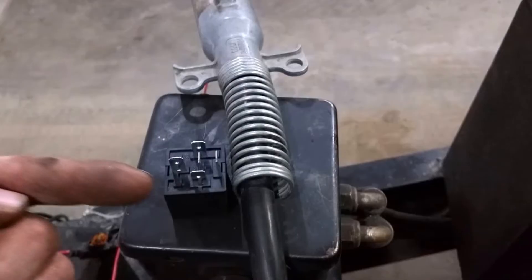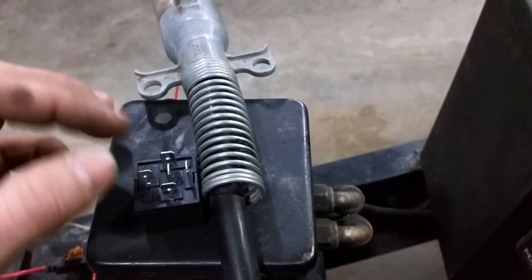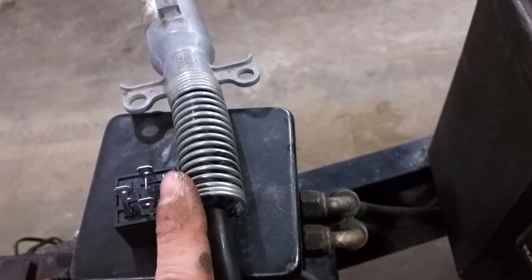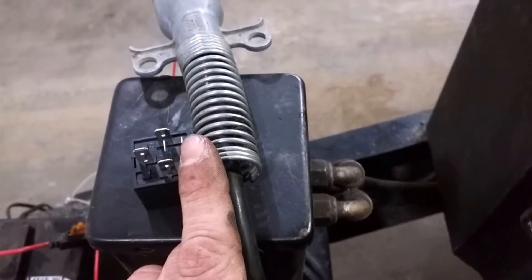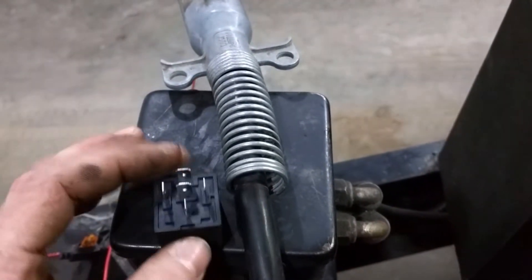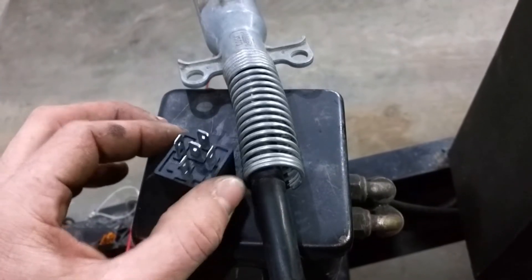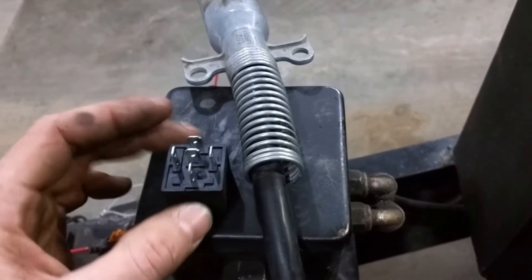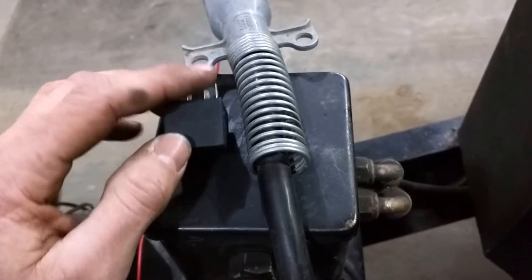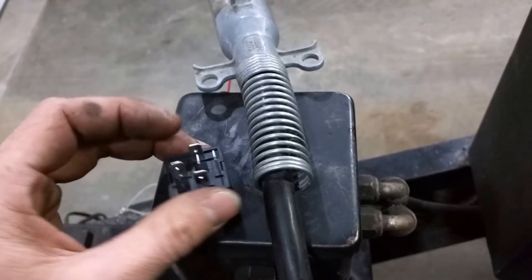Wire from the truck comes in and you splice it on the pigtail — one goes to the truck, the other goes to the battery. You're then left with three remaining terminals. One goes to your test light — find the positive on the test light and ground the negative somewhere so the test light works. Most DC relays don't have polarity on the coil, so it won't matter which is positive or negative. However, if you get one with a built-in LED indicator, polarity will matter — ask at your auto parts store. This relay is from NAPA and polarity doesn't matter on the coils.